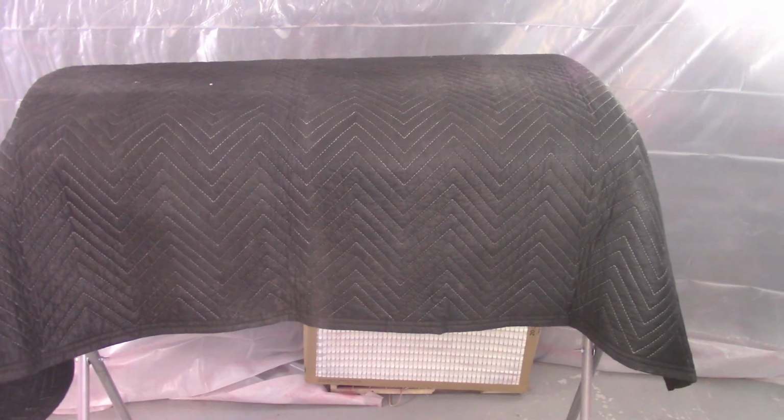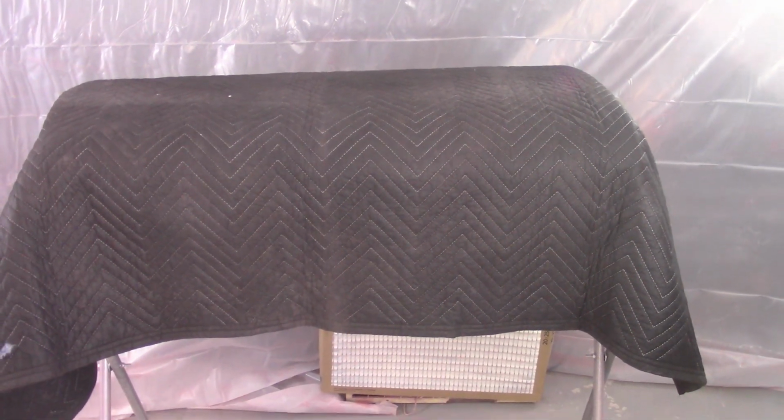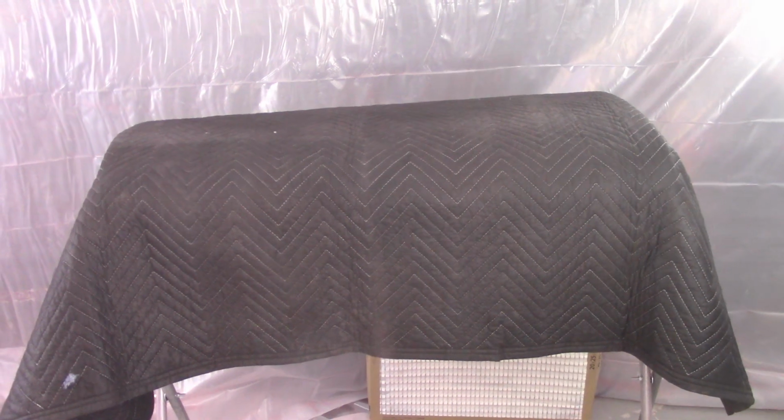All right, getting ready to go here. First coat of red. This is the door. I'm only going to put 2 coats on the door. So that's covered up just to prevent some incidental overspray and it falling out and kind of getting gritty. I'm afraid because I'm not going to lay it down wet that it would dry and get all dusty looking.